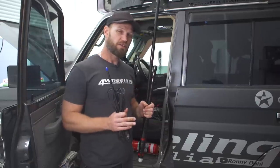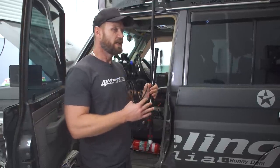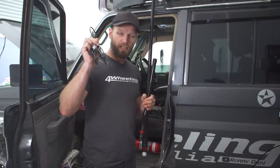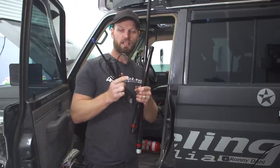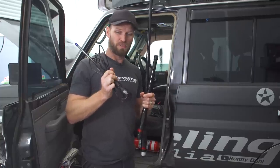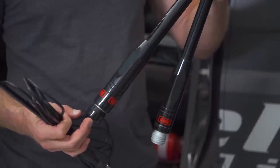The first thing you need to do is lay out the cable and the antennas and the head units where you think you're going to put them and make sure you have enough length on cable. Now, let me just say right here, in case we don't say it later, never, ever cut your cable, because these cables have to be at a certain length. If the cables are not long enough, then you'll need to go to a professional and get it extended or get a longer version, or you'll need to work with what you have.